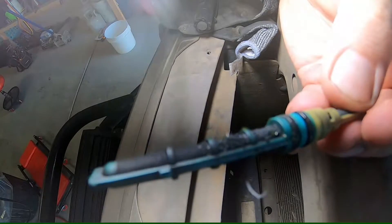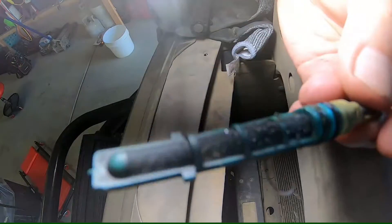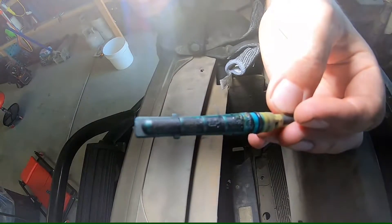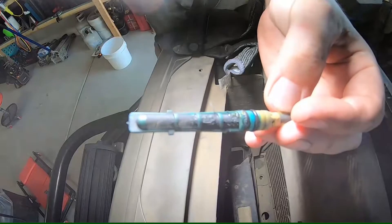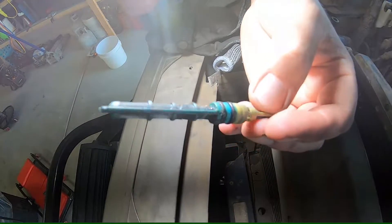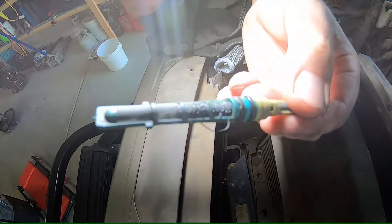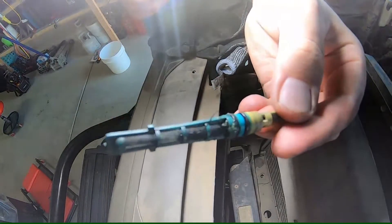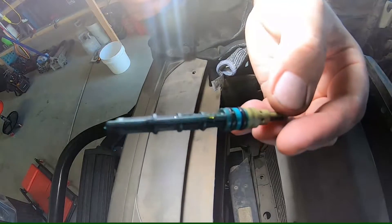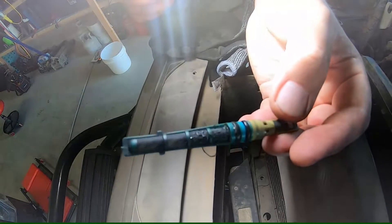It's very important — when all those metal flakes are going through the system, they're going to lodge themselves into various places: your condenser, your orifice tube. All that's going to affect performance and destroy your new compressor. This is why we replace all those parts and flush the system. My brother hasn't had AC since he bought this truck. My guess is they replaced the compressor to sell it but did not put oil in it, and that's exactly what happened.